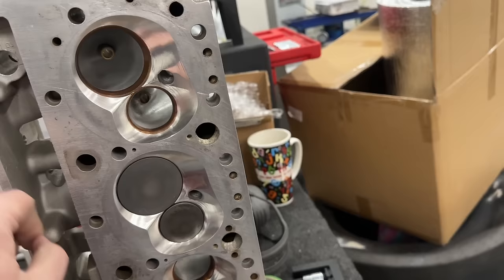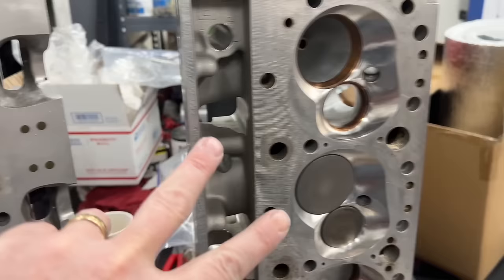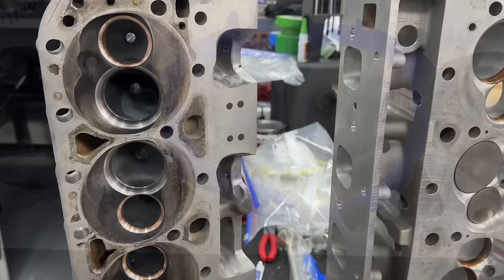And as you can tell, look at the valve rotation on it compared to this. This is actually a 21 degree head, by the way, not 23. See those? Those are marks for where the epoxy is. But anyway, these are 21 degrees and they're wedged. They're in line. The SB2's rotated. But anyway, I'm going to do a video for each one of those. It should be kind of neat. But that came in. It was pretty cool. But let's look at some other stuff.